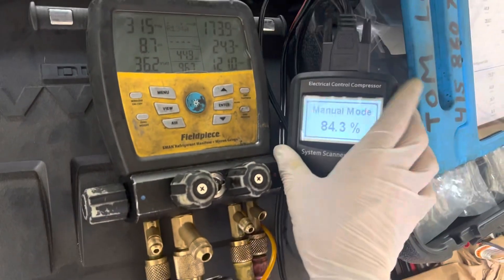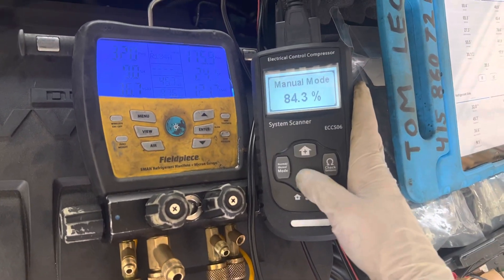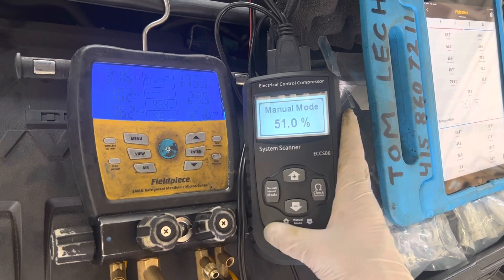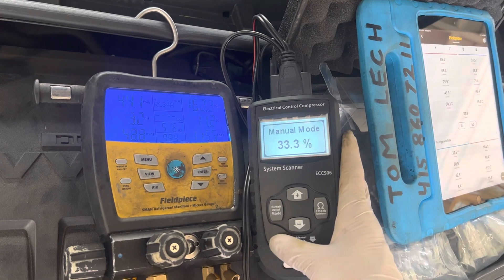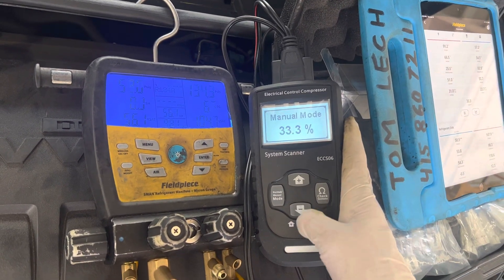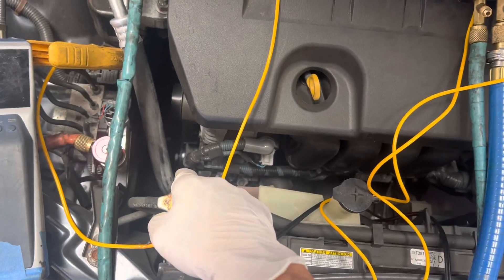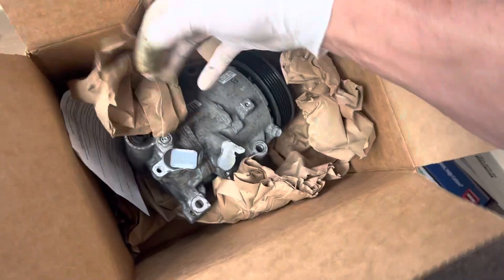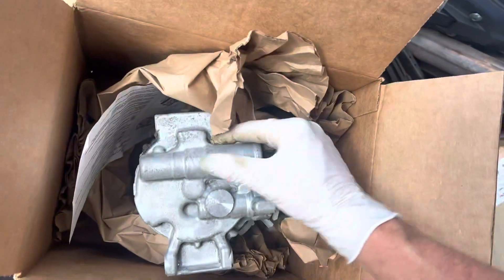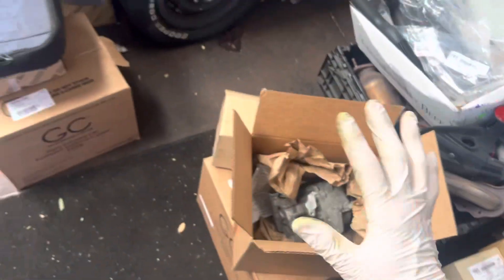Let's go over here so you guys — some of you like looking at a set of gauges. Can you read that? Watch the high side and low side pressure. I'm going to bring it back down — coming down to 50. I'm going to come down some more, just about basically kicked out almost. I can hear the load on the engine drop off. Now I'll go all the way down to zero — the compressor is basically off. It's still spinning because this is a clutchless compressor — there is no clutch on here. The displacement is no longer making a high displacement. Eventually the high side and low side will nearly equalize. Here's the compressor, and this is the valve in the body that I am commanding to change the swash plate on the inside, while the compressor continuously spins no matter what.